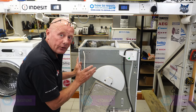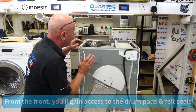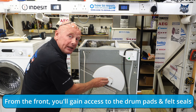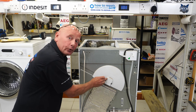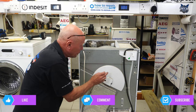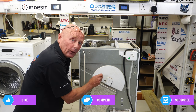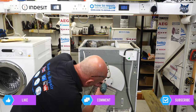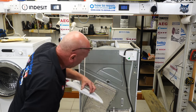There are two ways of replacing the belt: you can either strip the machine down and replace the belt over the front, or you can go through the back. The reason I always go through the back is because there is a separate little phosphorus bronze bearing, and it's always a good idea to inspect this bearing when stripping the machine down, as it is a very common fault. Using a screwdriver, there are two screws, then the cover will come away.